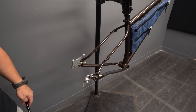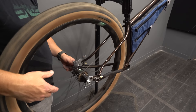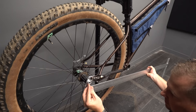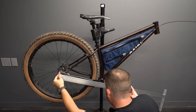Let's see what size tires we can fit in here. Here's a 29 by 2.8 on a 40i rim. That's got clearance — we've got 7mm clearance on each side on a 2.8, and the dropouts are probably 75% back. Let's measure the chainstay length — that is at a 428 chainstay, which is impressive. I don't think I'll be able to slam it all the way forward. This is as far forward as I would want to run it — we've only got 3mm clearance here, but this is a 422 chainstay. Very impressive.